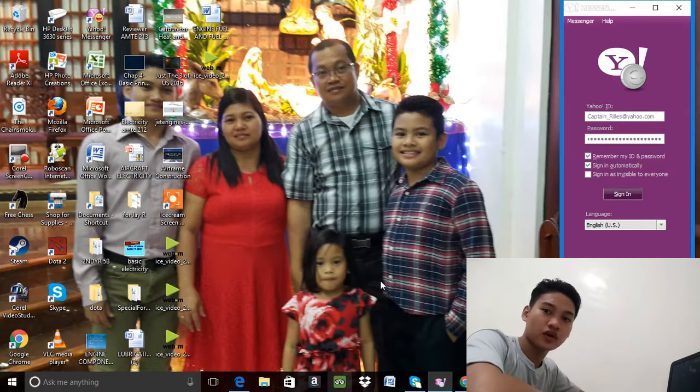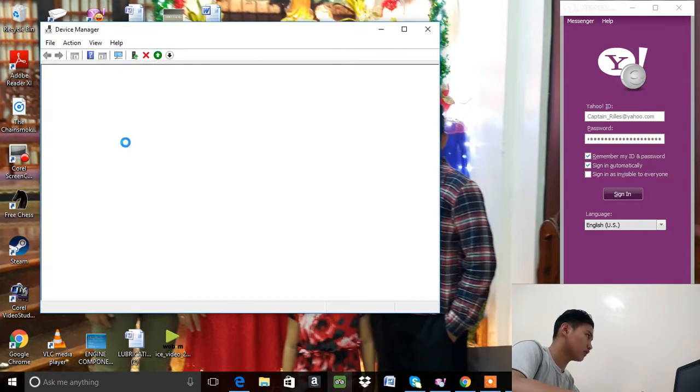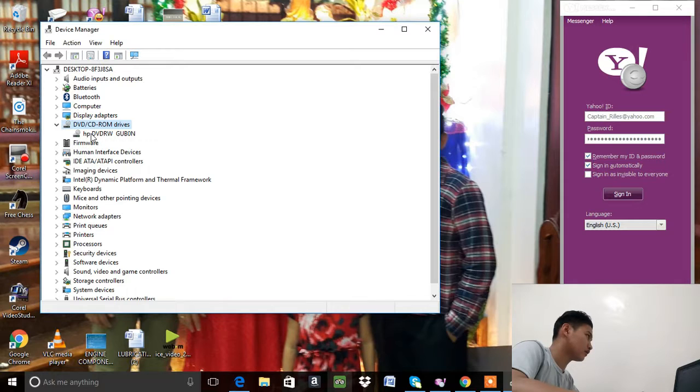This topic will teach you how to install and uninstall the hardware or device. Open Device Manager and then double click the type of device that you want to uninstall. Now I will choose the DVD. Double click and then right click the specific device you want, and then click uninstall.